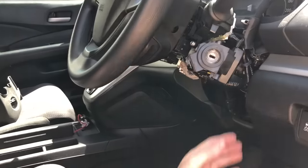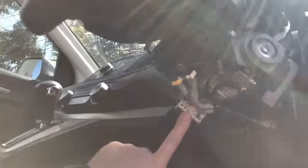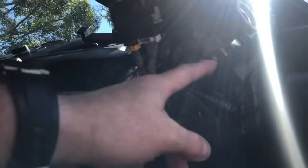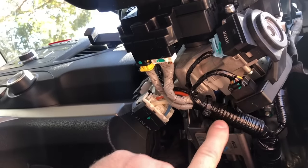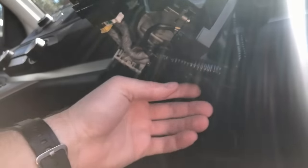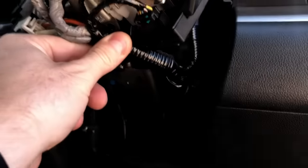These are the two looms you're going to need. On the left-hand side is the main power ignition loom, and the other is the ignition immobilizer loom. This does not remove any security on your car — it actually retains all your security because it's designed for the vehicle. It just bypasses security during the remote start stage. There's going to be a cable tie — white or black — around this section holding the loom up. You're going to cut that off to give yourself room. Cut one here and one here to make the loom looser, and cable tie them back after the job.